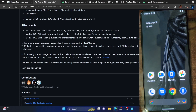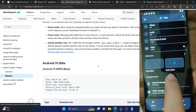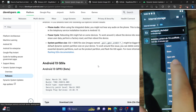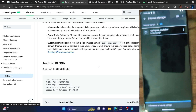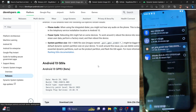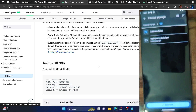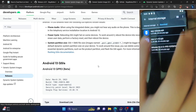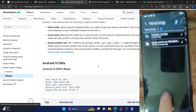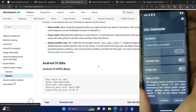Let's now replace the Evolution X ROM with the official Android 13 GSI ROM, which I downloaded from the official site. Go to the file app, then internal storage. Under the GSI folder, move the Evolution X ROM somewhere else as a backup. This is the Google GSI ROM official build — let's move it to the GSI folder. Whatever ROM you want to flash as a dual boot should be placed in the GSI folder. Under the GSI folder, it's now the official Google Android 13 ROM.